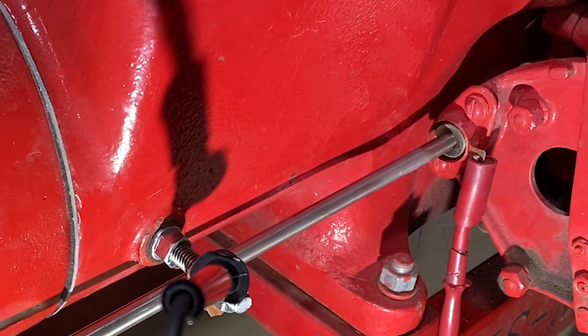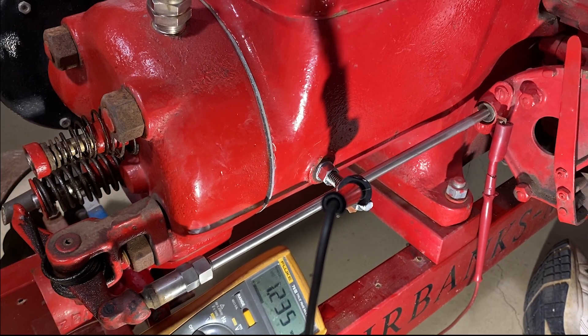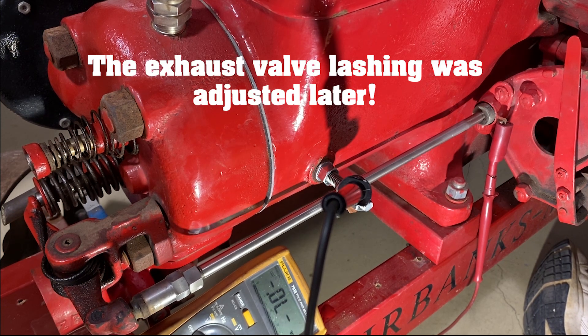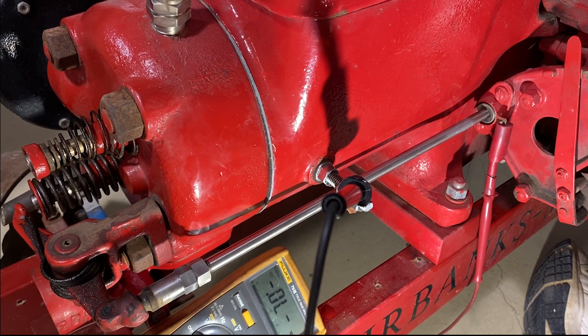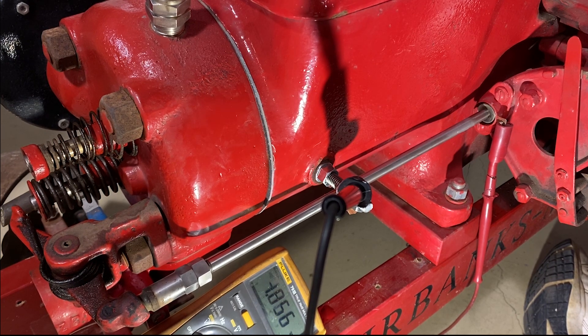We will spend a lot of time on this subject. I connected a multimeter between the contact and the engine block to verify it was working. Watch as the exhaust valve operating rod moves back and forth and the contact in the cup makes contact with ground at or near top dead center of the cycle. This point can be adjusted by adding or reducing shims behind the cup, thereby advancing or retarding the timing.